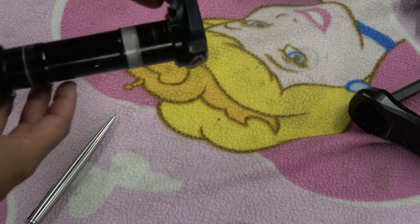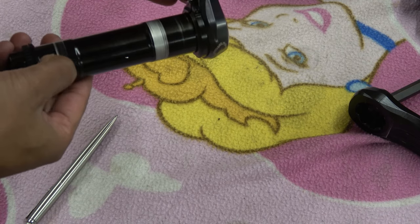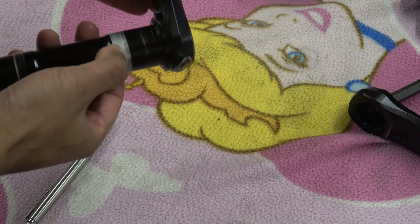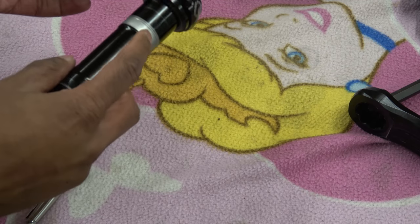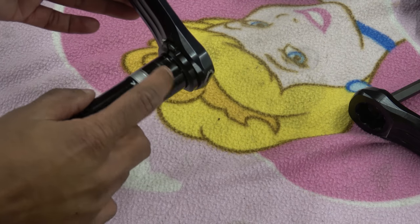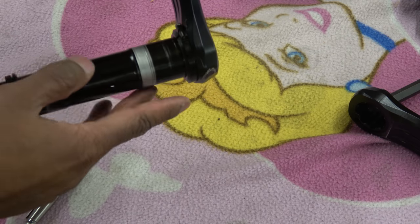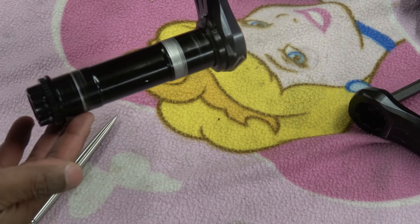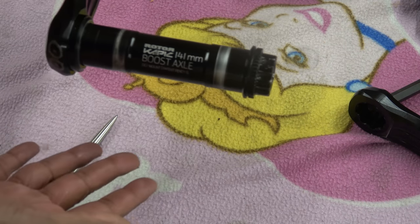This has had horrendous misalignment. Over here if I run my finger over it — there's a huge lip on there, an absolutely ridiculous lip. I've measured this and it's about 29.9-ish millimeters, whereas the virgin untouched material is 29.98 to 29.99 — so it's a 30 mil axle. I've also checked along here and it is not bent. Rotor — I don't think there's a problem with the axle itself.